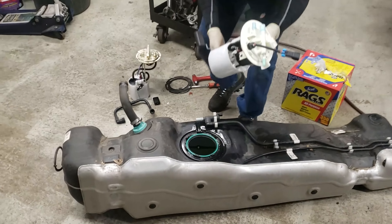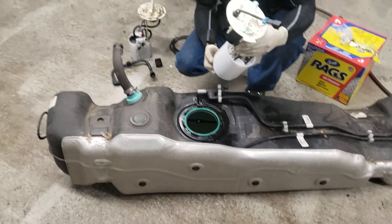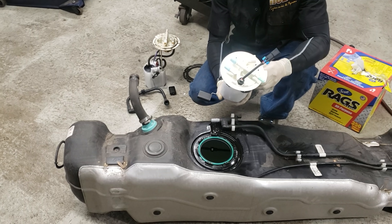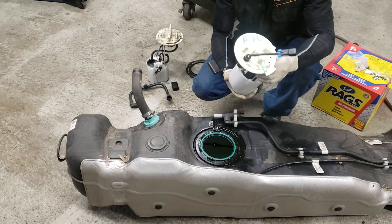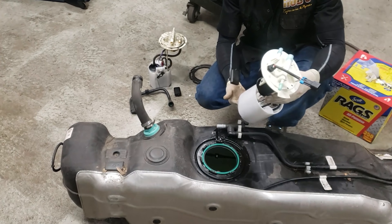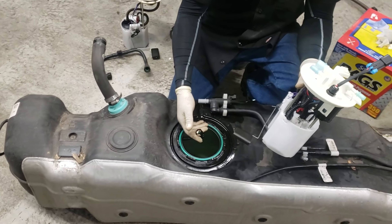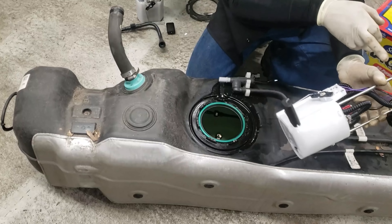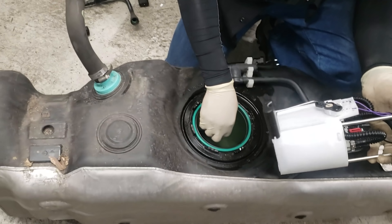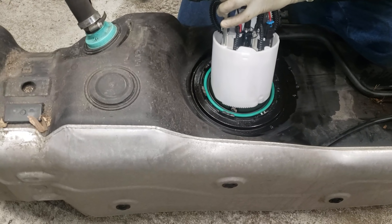This is the upgraded fuel pump — it's a drop-in, ready-to-go deal, a really nice piece. The work that was done on this thing looks like it came from Ford already. I got no complaints — I'm seeing a lot of good OEM connections and it does support the fuel you're going to need for this application. I'm going to connect this onto the bottom of the pad of the actual fuel pump, then drop it back down in there. You can't connect it outside of the tank.